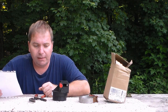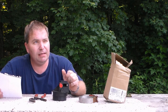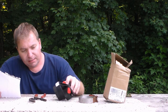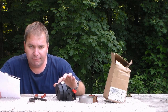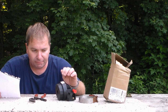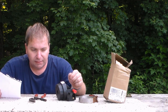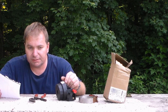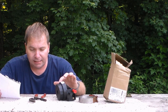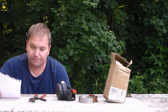Okay, so another vital question that I get asked is, what type and what part number filter do I need? Now this is a cartridge type filter. It's not like most of the fuel filters that you put on most of the trucks. Most of them have the canister type, in a metal can. It comes with two clips, or sometimes they use the quick connect. But this is not like that. It's a cartridge, kind of like an oil filter that's had the housing cut off of it.